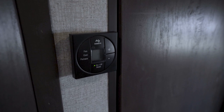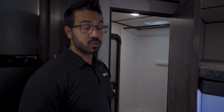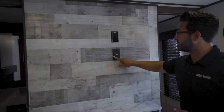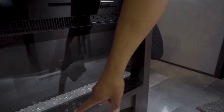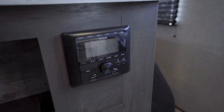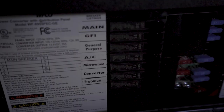For the bathroom, the main thing is the toilet's foot-flush lever: push it down a little to fill the bowl with water, then push all the way down to flush. There is storage in the back with a handle — easy to access. Up front is the entertainment center where your TV goes, along with your antenna booster and Wi-Fi if equipped. Underneath is the fireplace, which needs 120 volts to run. The multimedia center controls the speakers inside and outside. Lastly, the fuse panel — pop it open and you'll see the 120-volt AC breakers on one side and the 12-volt DC fuses and breakers on the other for any electrical troubleshooting.